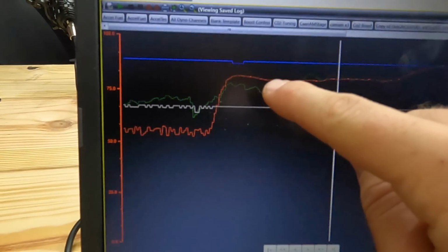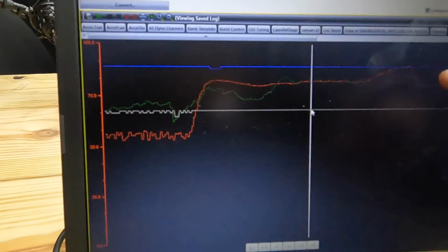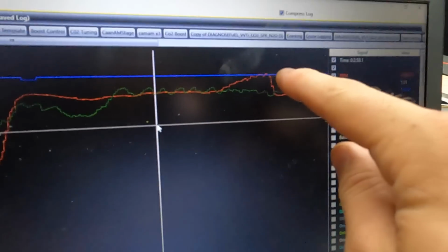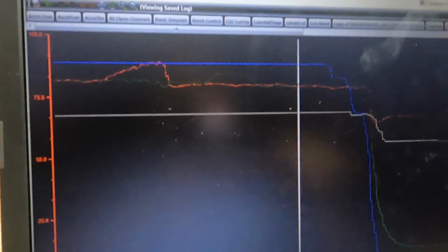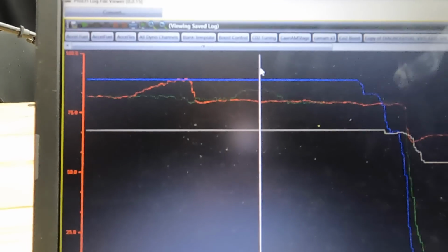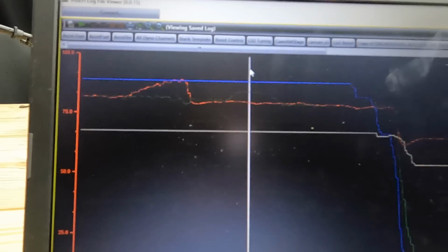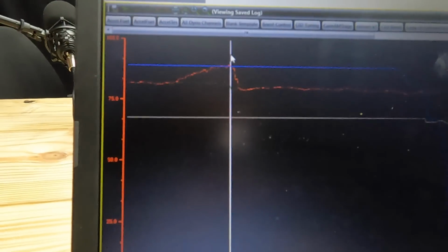So it raises so quickly now. It used to be like here before it was fully coupled, and then it just carries across, goes up a little bit right before the shift, drops back down, and then we carry the shift out all the way. Obviously that's the MAP sensor, and it was kind of a little bit up and down, but nothing too crazy.